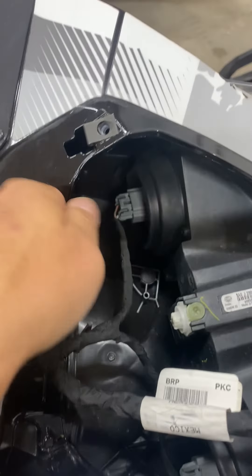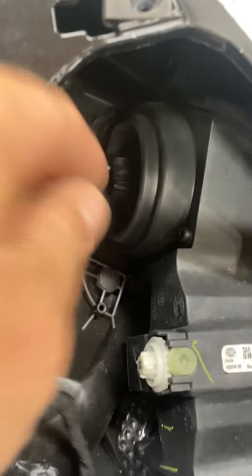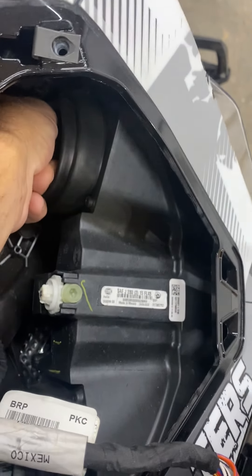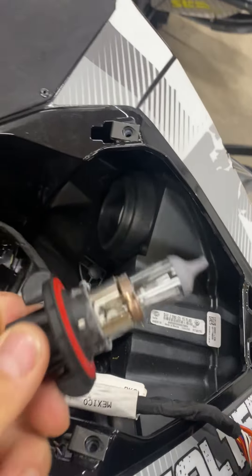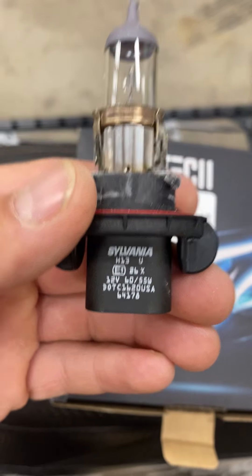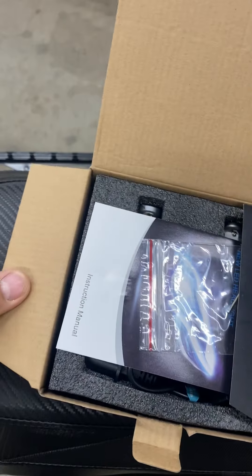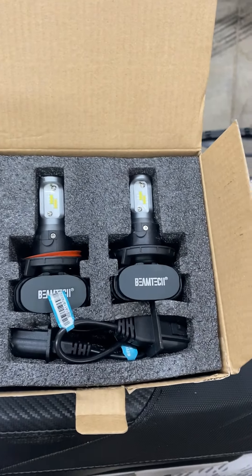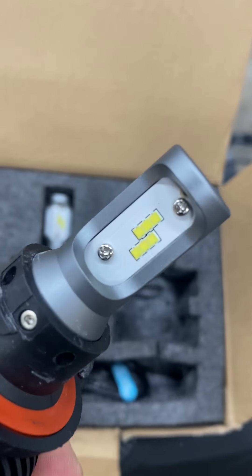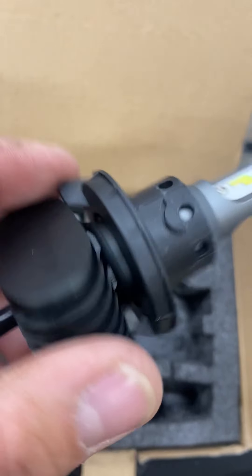Okay, headlight plugs right here. All you're going to do is unplug — just move it out of the way. That's the plug for your headlight. If you look down in here, it's got little thumb tabs right here and it just twists — it's going to twist to the left and it's coming out. These are the BeamTech H13. As you can see, the stock is an H13 bulb. I bought these on Amazon — I'll put a link below — 29 bucks or something like that, and they are supposed to be a direct fit.